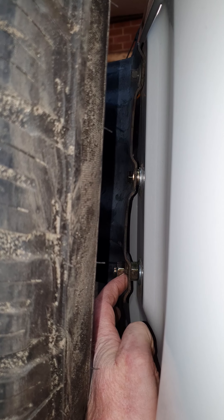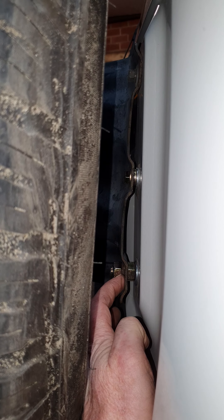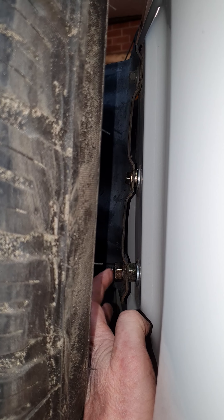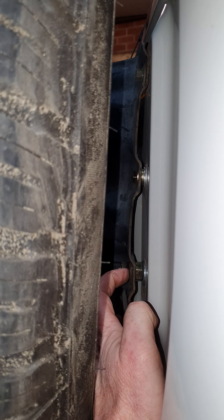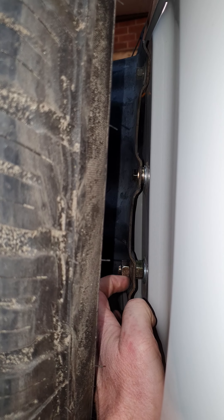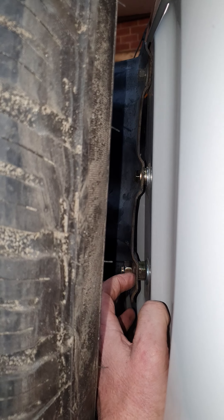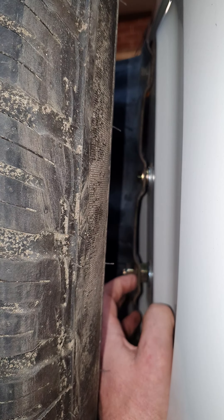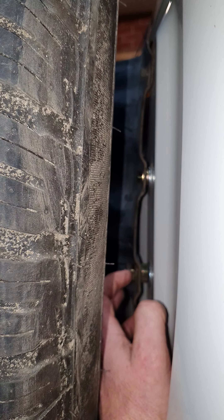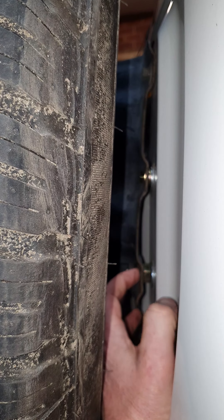You might think it's a press-in stud like a wheel stud, but unfortunately it actually seems to be welded in and because it's hardened, I put my press on it with a socket on the back which was a neat fit around it. You'd think there's only one way for it to go and that is off, but it actually started deforming the sheet metal around the nut, so I thought this is going to end up a little bit messy.